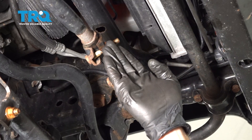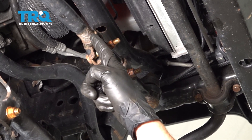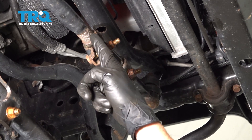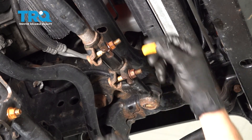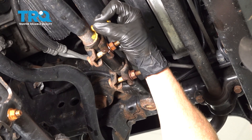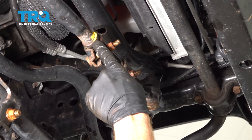Let's have a look up at this area right here. We want to pay attention to the threaded area that's on the tie rod right next to where the sleeve is. Typically I like to mark the tie rod ends that I'm not going to be replacing. Let's use a crayon, make a nice big mark on this. That way we know exactly how far to put the sleeve back on when we go to reinstall.